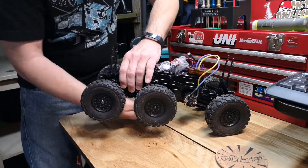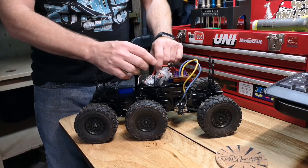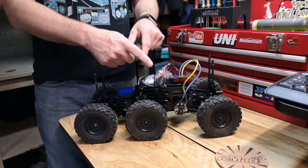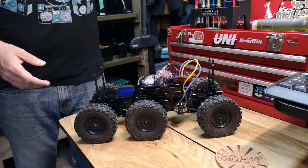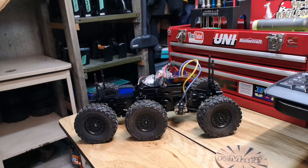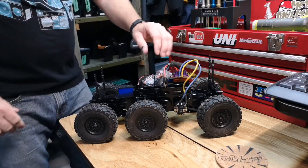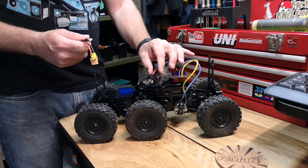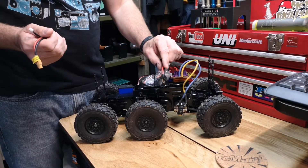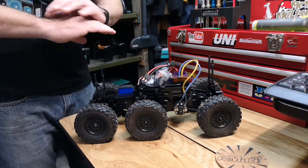Because Novak is now out of business. One thing I did — back to electronics — I'm running a Flysky receiver and then just a Traxxas plug. I'm going to be most likely changing all my Traxxas plugs to XT60. Traxxas was an amazing plug in its day, but now since you can't actually buy the plug itself, all the aftermarket ones are just terrible — absolutely horrible. They barely plug in; they always push themselves out.